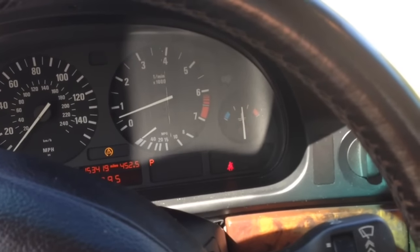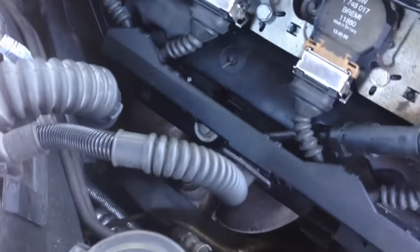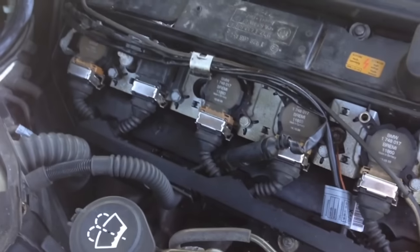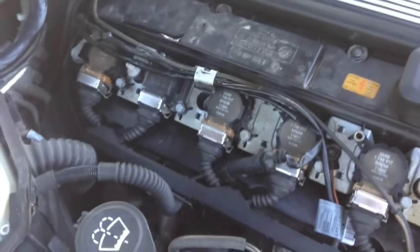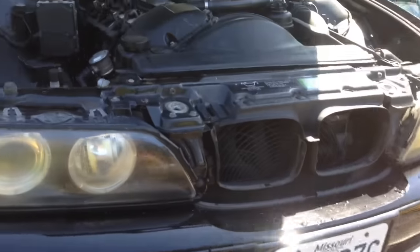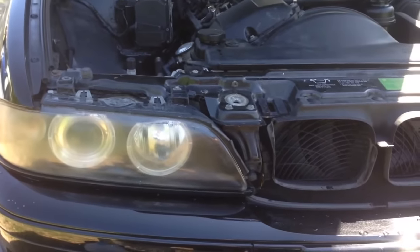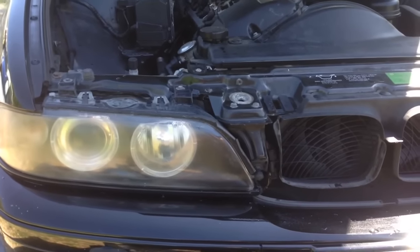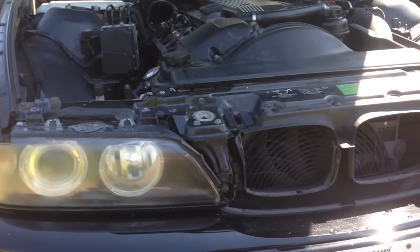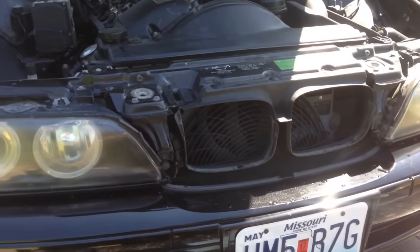The car's running fine, the oil leak is stopped. You can see back here there's nothing dripping on the manifold at all — it's all real clean and clear, never any smoke, nothing whatsoever. I think we're good on this, but we still need to go drive it. A lot of times these cars are okay driving slow. What we're gonna do is hit the highway with it and try to run it at 55-60 for at least 10 or 15 minutes, come back, come to a stop, then open the hood. We want to be 110 percent — we don't want to give this car back to these people unless we know for sure it doesn't stink and they're never gonna have overheating problems at all.